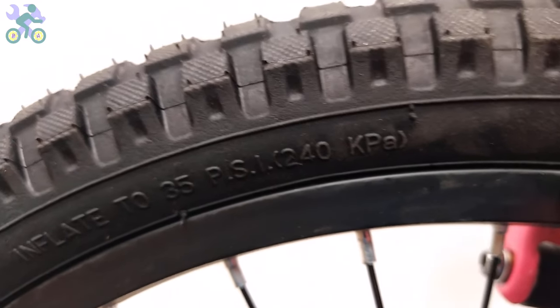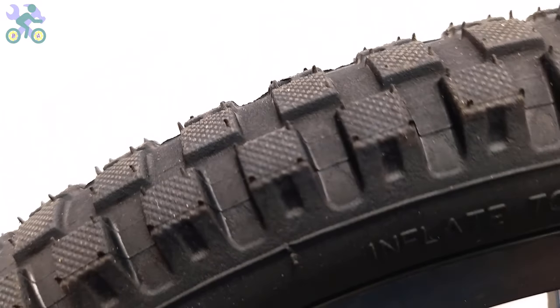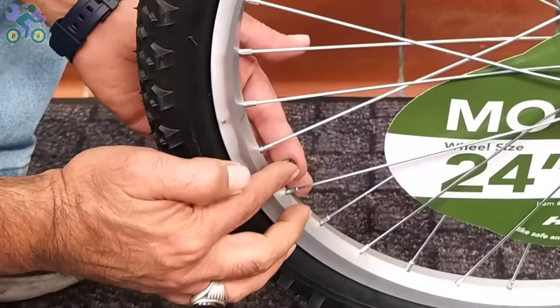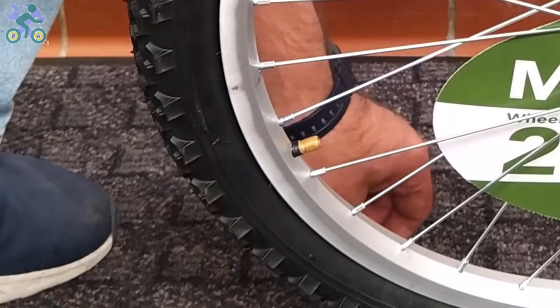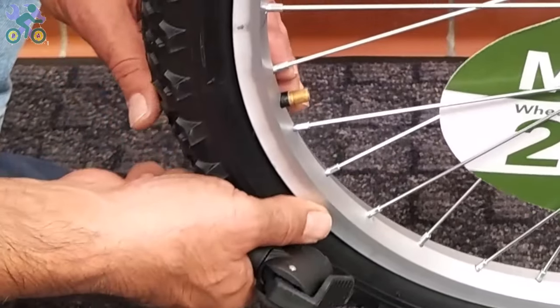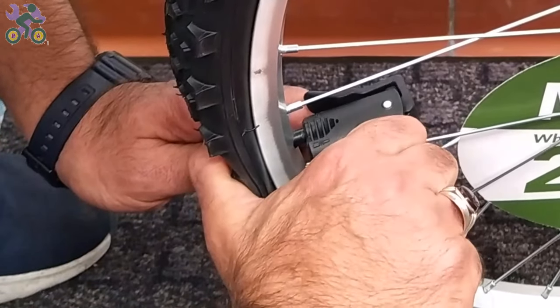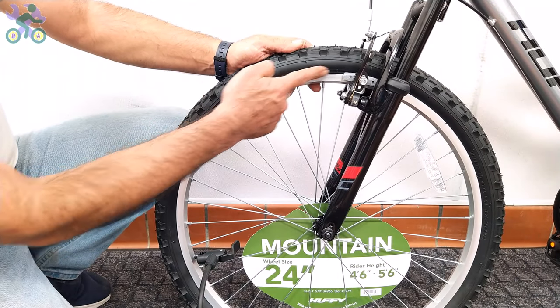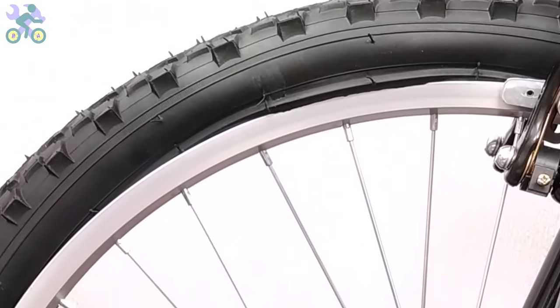For most bikes, the recommended air pressure is between 25 to 35 PSI. After inflating to 20 PSI, sit on the bike to check the tire pressure — if not fully inflated, increase the air. Remember, the weight of the cyclist determines the amount of inflation. To inflate the tire, first remove the valve cap and put the air pump head on it. Sometimes this is difficult because pressing the tube valve causes it to go inside. If the tire is slightly inflated, first deflate it completely, press your thumb on the back of the valve, and place the air pump head on it. Inflate halfway and make sure the tire is still on the rim. If part of the tire pops out, release some air pressure, put the popped-out area back inside the rim, and re-inflate.